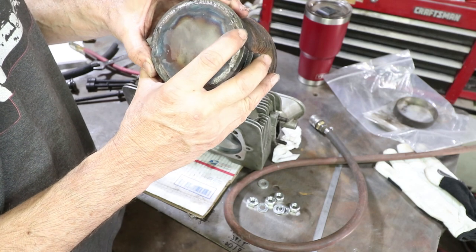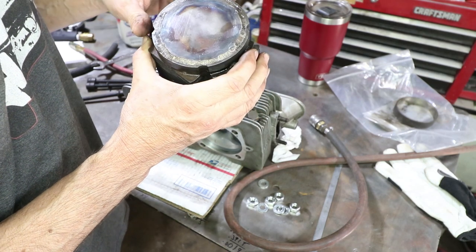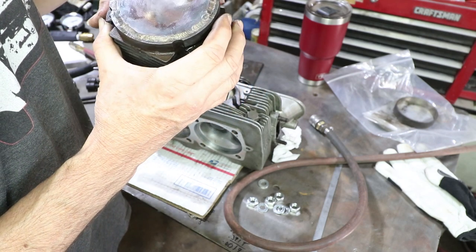Okay, I should also mention that 10% leak down is for a complete engine. That includes the piston rings. The piston rings are pretty much the only thing I'm not testing here, because I'm testing the head seal. I'm testing the valve seals, and that's really what contributes to leak down. I'd kind of like to fix this weld. I don't know where it's leaking from because it's hard to see with the plate on top. I thought I did a good job on this, but apparently not.